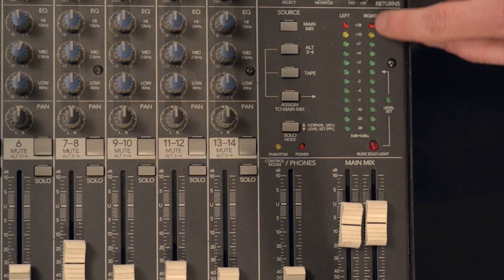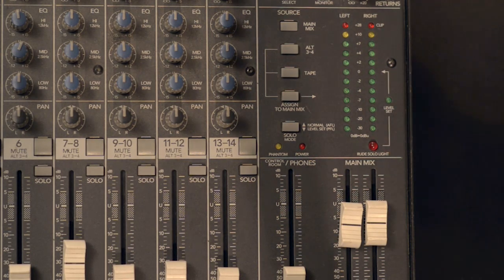A really good rule of thumb is to start low and move your volume control up, and keep an eye on whatever color code you have on your mixer — green, yellow, and red. Start low and work your way up, keep an eye on your signal. Have your actors or your source of sound speak as loud as they're going to be throughout the performance, so you can find the maximum volume level and adjust your master volume control to get a good, clean, powerful signal, but stay well away from the red. You never want to go in the red.